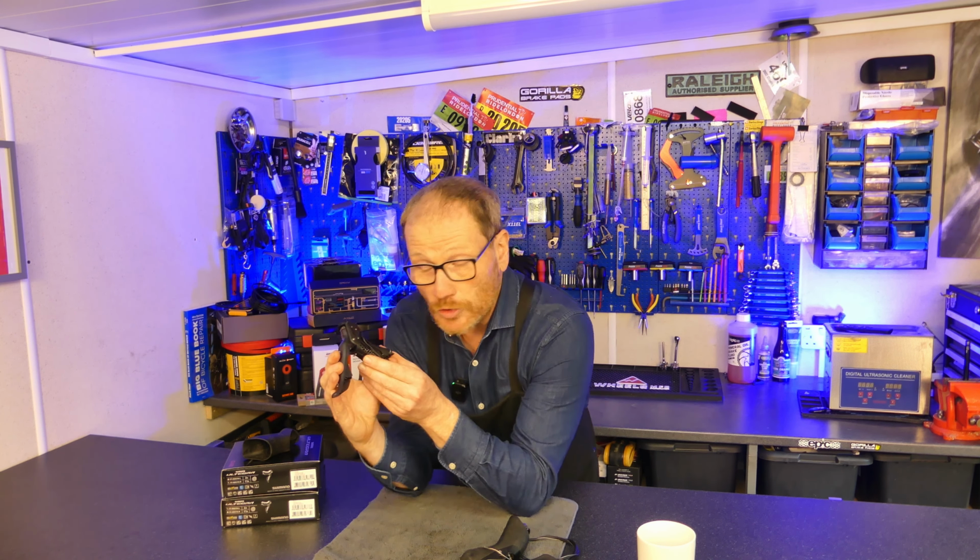The vast majority of modern Shimano levers have what is known as a reach adjustment, and some of the higher end levers also have an additional adjustment which is called free stroke. Now if I'm being honest, the vast majority of riders nowadays are aware of the reach adjustment, but not so many know about free stroke adjustment, or more importantly, how to set it correctly. So the first adjustment we're going to look at is the more simple of the two, which is reach adjustment.